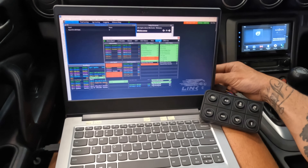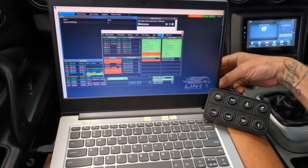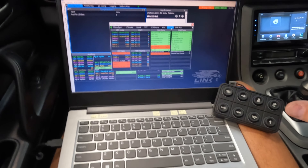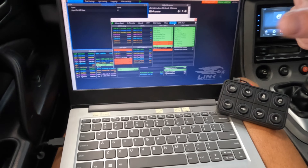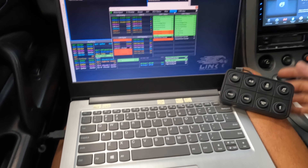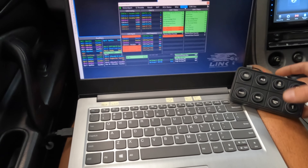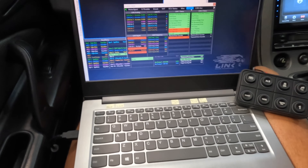I've just got the keypad all programmed up and ready to go. I'll show you some of the cool little features, some of the lights and everything. First thing - when you turn it on, it'll do this little light-up sequence. You can change that and have it do different things if you want, or not have any lights - so on and so on. Fully programmable. Some of these buttons you can use as a momentary, so you have to hold it down and as soon as you release it, it releases. You can also do a latch style button, which would be like a normal toggle switch - you turn it on and it stays on until you turn it off. That would be this one here for my water meth injection.